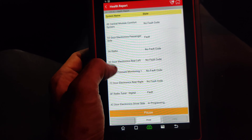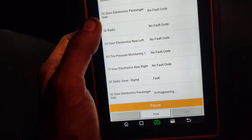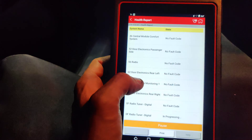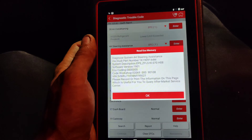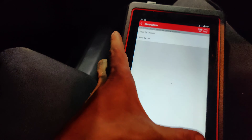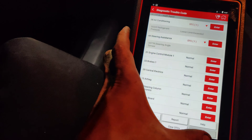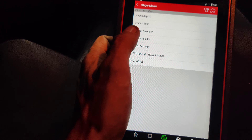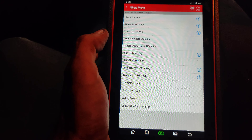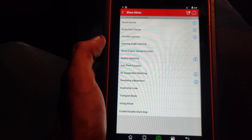So let's shut this off, start it back up, and see if our light goes out. Oh, look at that! So now I just need to see what these other codes are for - we might have to zero the steering wheel. So it says steering angle sensor, and a couple other things - steering angle sensor. So let's clear these, see what comes back. I might have to re-zero it. So we have no fault - steering assist still is a fault. I wonder if I have to re-zero it.